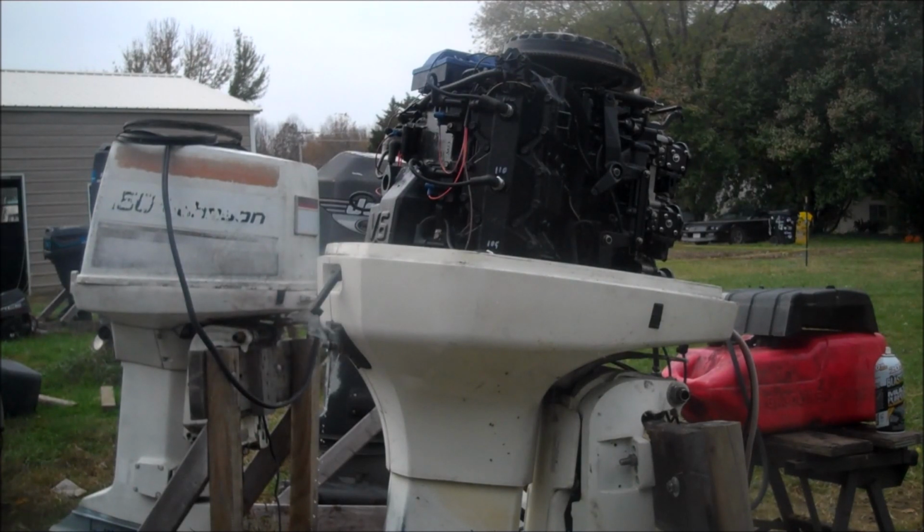Alright, so far what we've done is we've added stabilizer to the gas and put that in the carburetors. We have squirted fogging oil into the front end of the motor, and we have thoroughly flushed out the entire coolant system with good water. What we're going to do now is take out each of the spark plugs. We're going to spray the same fogging oil into each cylinder head, and then we're going to hand tighten down the spark plugs. Remember, when you go to start this motor up again, it's going to smoke like hell as all that lubricant gets burned out, but it should clear out.